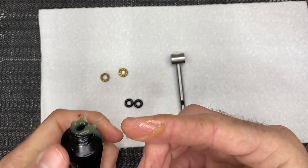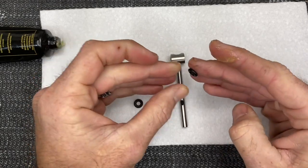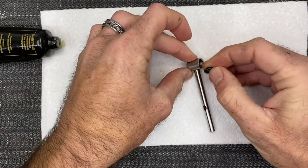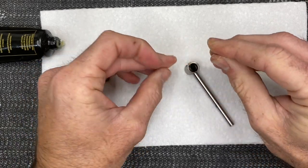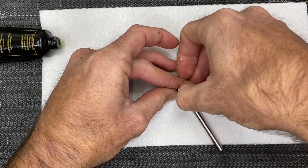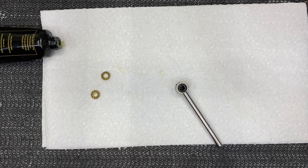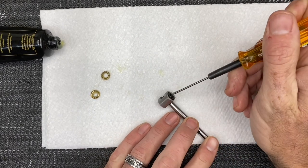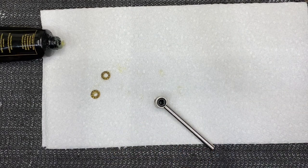Your O-rings, your tail dampeners — just a little bit of micro lube, not too much. Take your tail dampeners and grease them up. Once we're happy with the grease, we're going to insert our dampeners. Grab the next one, grease them up, roll your tail shaft over, insert the dampeners, then come back through with a little driver and wipe the excess grease out of the inside so none of it gets into the threads of the spindle.